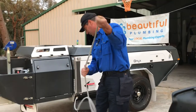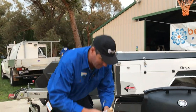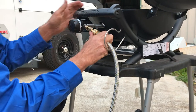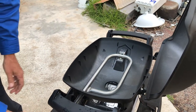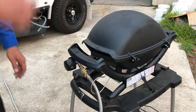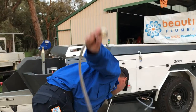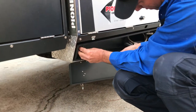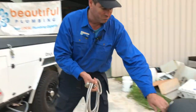This end has got a dust plug too — just pop that out. No gas is going to come out even though the whole hose is live. Just feed it through to your normal bottle. What I normally do is put my thumb on it like this, pop it on, and then turn it on at the top. Give it a bit of a spark and you can see it light up — good to go. Normally it's got the grill in there of course, but it's a lot lighter when we're doing this demo. To pack it up again, put your thumb on it, pops off easy enough. Grab your dust plug, pop that back in, then take it off, get your other dust plug and pop that back in too. Roll up your hose — you can usually just chuck it on top of the barbie.